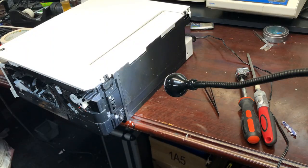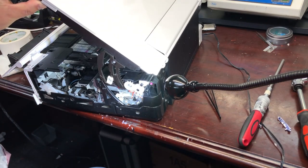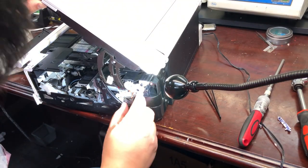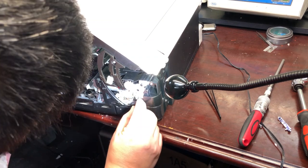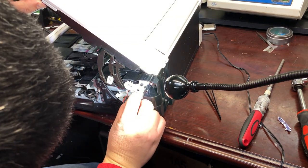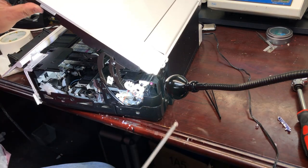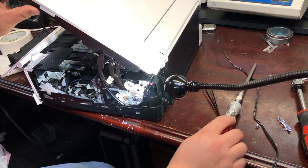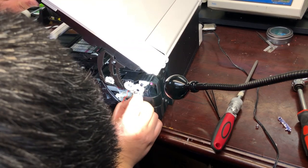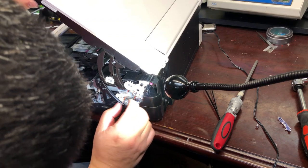I gave up. Then when I come back, I found this thing. What the hell is going on there? It's a piece of wonderful Canon design — why they power their motor with this really, really thin wire? Why do you put the wire just right next to two gears that are going to be grinding on them? You're going to have the same error for all the new Pixmas that use this cartridge.